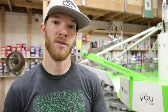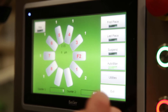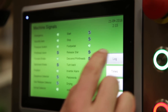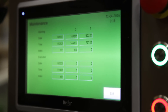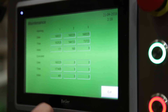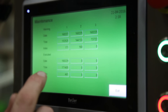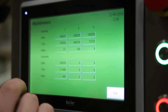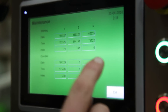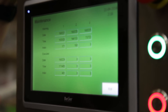Repeat this process on all your additional print arms until you're done. Then we'll go ahead and reset the password. Go to Utilities, Detectors, Log. Tap reset and there will be a login — choose Technico, the password is one through nine, hit OK. Login successful, hit OK, and then hit reset one more time. Once you do that, the little maintenance indicator is gone and you're ready to rock.